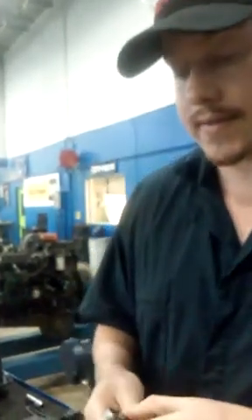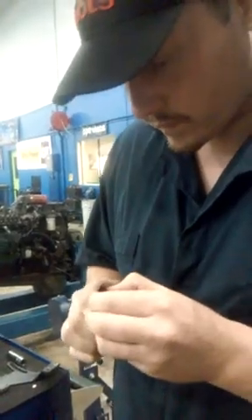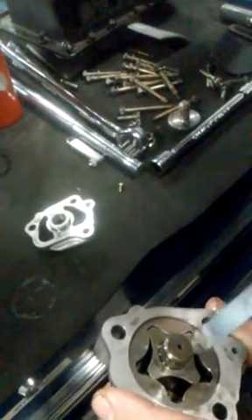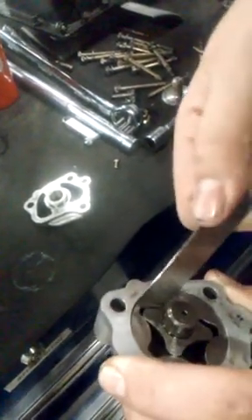Next, you're going to get your tool here. With your certain specifications — you can find them from the manufacturer's website — you're going to use the specifications with this tool. I don't know the exact specifications for this one, but I will show you how to use your feeler gauge on your oil pump to make sure it's within spec. So once you know your specifications, you're going to pull the feeler gauge out with the proper number on it. Once you pop it out, let's say this was supposed to be 0.006 — you're going to take that and pop it in there. As you can see, it's not going to fit at all, which means I most likely need a smaller feeler gauge.